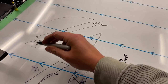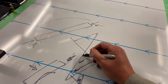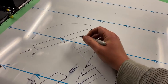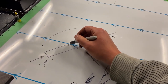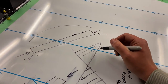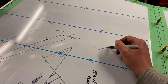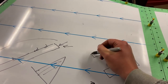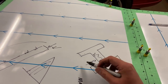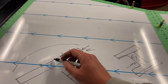You have high compressive forces here operating at the extreme fibre at the bottom, and also high tensile forces at the top operating right at the top. So if you're drilling holes in the top section of this square tube, you're taking material out of the section that's actually copping the brunt of force. This actually explains why you would have an I-beam - the reason they're shaped like that is because you have all the force at the top and all the force at the bottom. You don't have much going on in the centre, so you can even drill holes there and it doesn't really matter. Saves a lot of material and weight, but you've got maximum material where it counts.